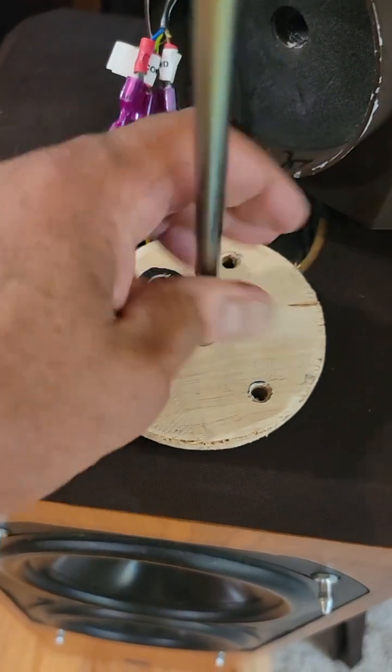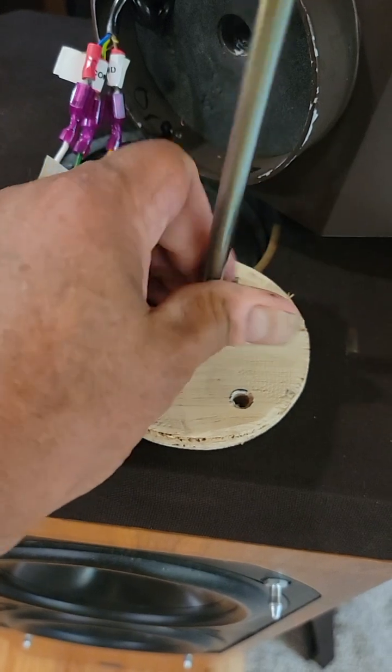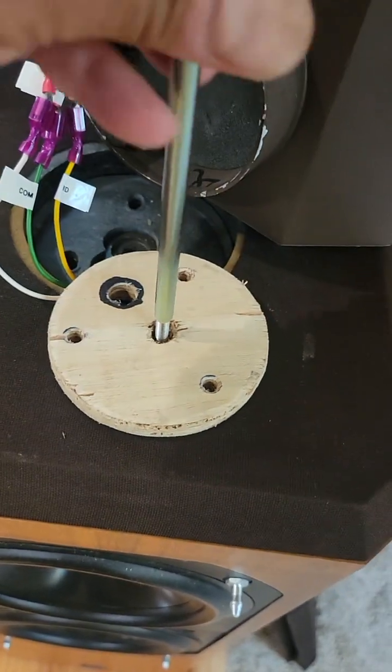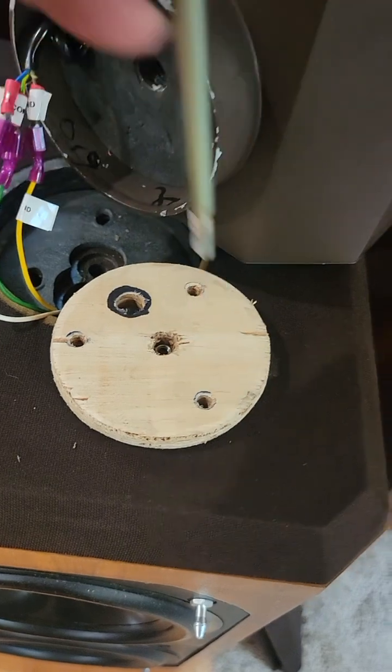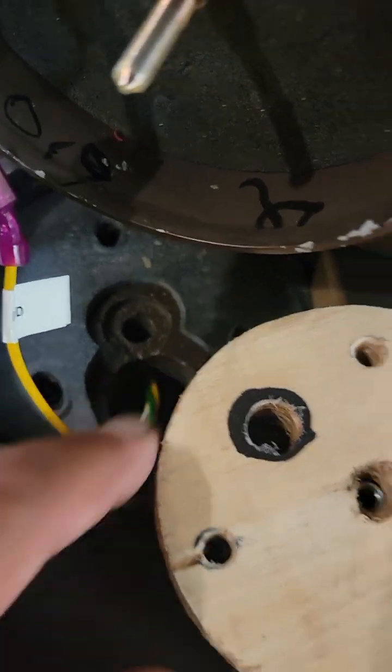Here's how we fixed the plate that goes in there. This is the screw that goes through the top of the speaker mid assembly — you just slide it through and it doesn't go all the way down. So you can't put a regular nut and bolt in; you have to make this fiber disk replacement. I made it out of half-inch solid plywood — it's not going to break off, it's not going to move — and I drilled it out using the original as a template.